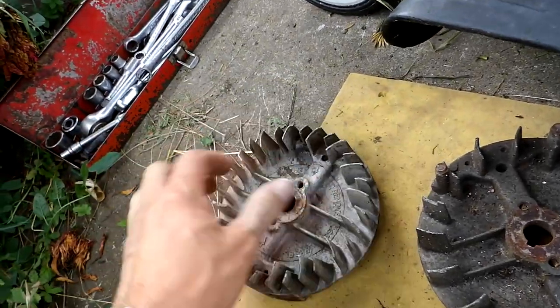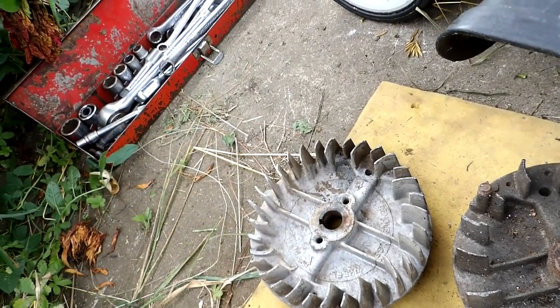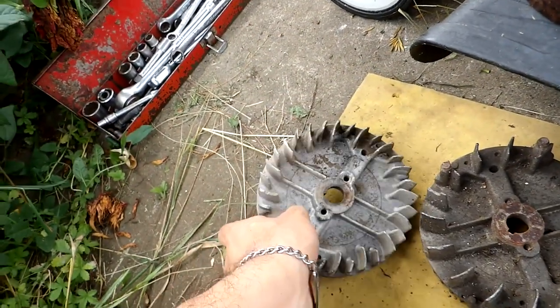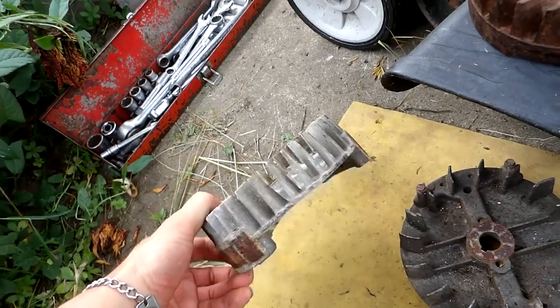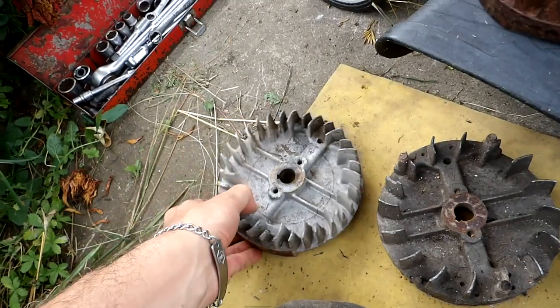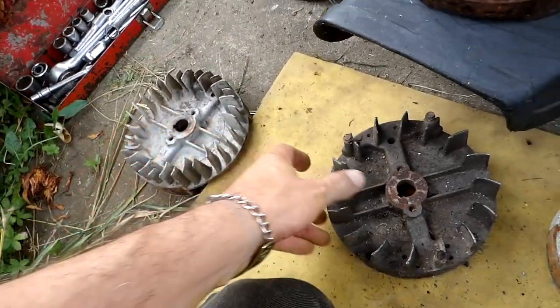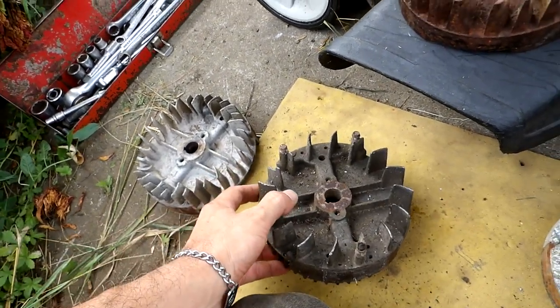It's so light that it won't work without a blade. If you try to start it up like I just did, it'll backfire, shear the flywheel key, and yank the recoil starter right back — and hurt your fingers in the process. I'm talking from experience here, unfortunately. So that's the light lawnmower flywheel — no good for running the motor by itself, like on an outboard motor or a go-kart.